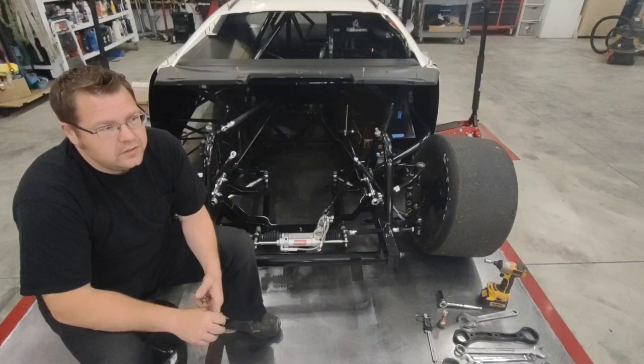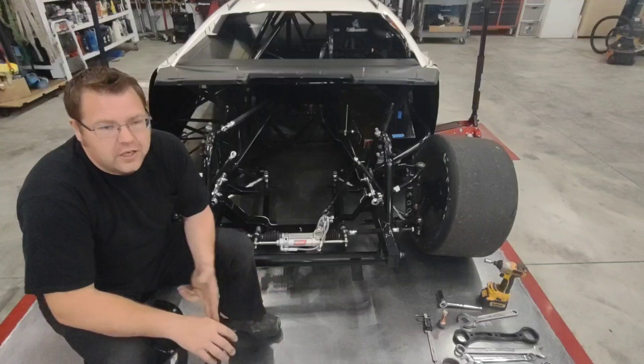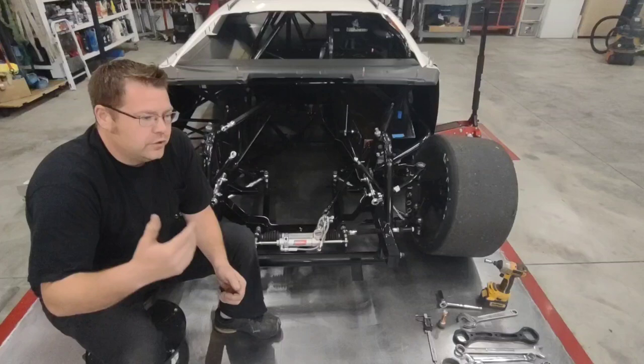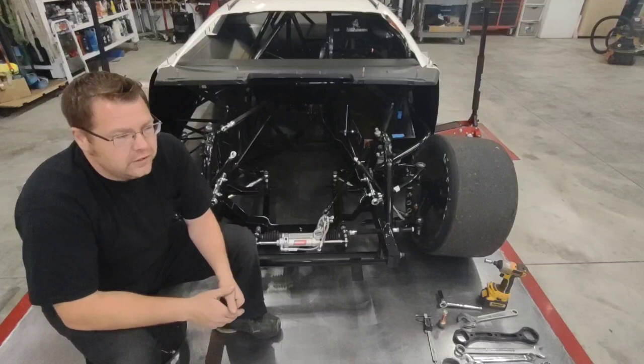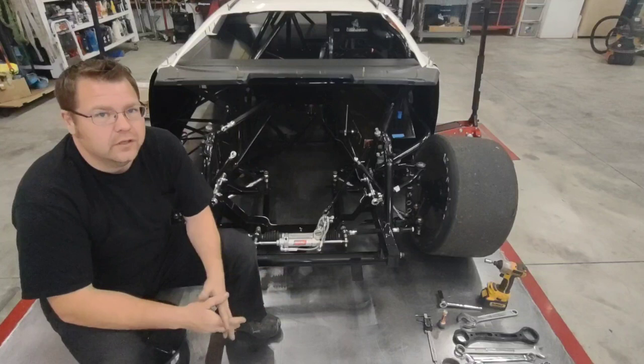And by making your race car better, you will find it easier to hit your marks, easier to get back to the throttle correctly, not overwork the brakes. The brakes are a major factor in short track racing. On a long run, you're using a lot of front brake, you build that air pressure up, the car starts to get tight, which causes you to use more brake, unfortunately. Next thing you know, you're glowing rotors, the thing won't turn. Because it won't turn, you can't get off the corner. It's a downhill spiral. So little things definitely make big things over a longer period. Always keep that in mind. Manage your brakes, manage your tires, manage your wheel input.